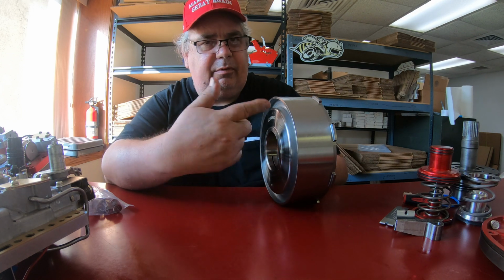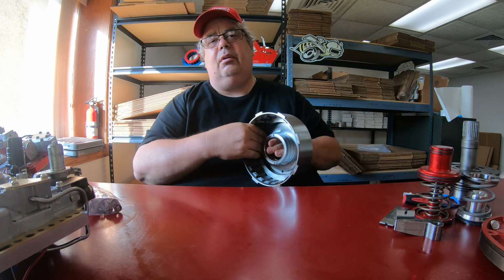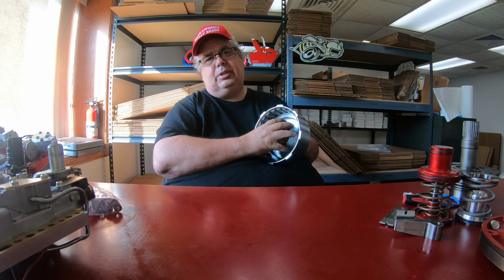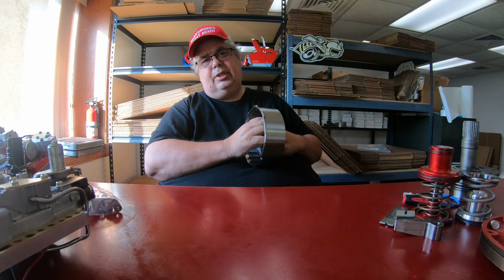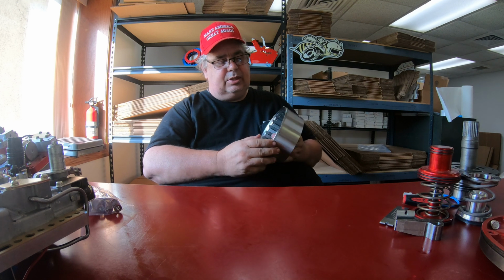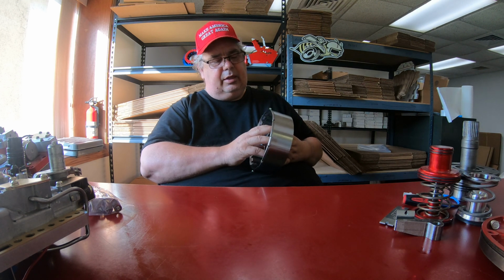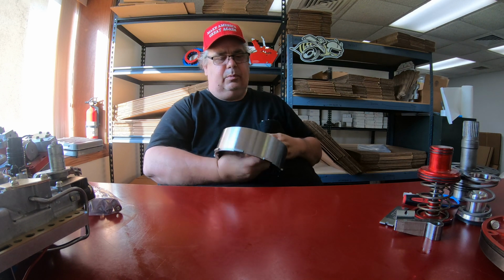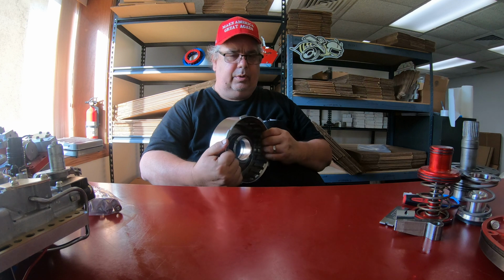2.45-to-1 ratio in reverse, and the fluid that's still in here could gather and still apply the piston. So that relief hole allows that oil to escape out of there, and then you have no chance of these clutches coming on hydraulically in first gear when this drum's spinning the opposite way. And it makes for a clean release also. So there's the two reasons.